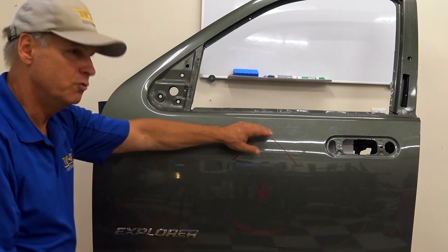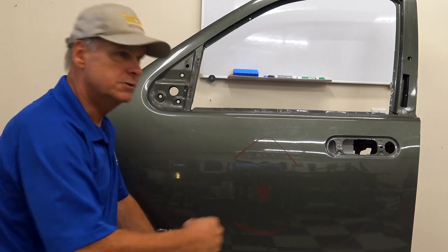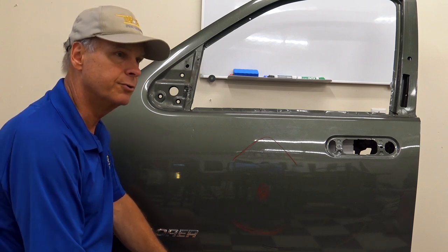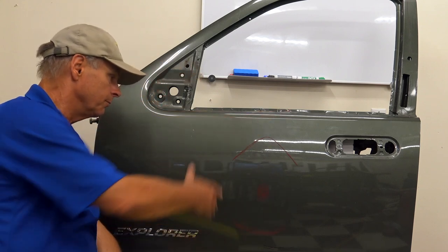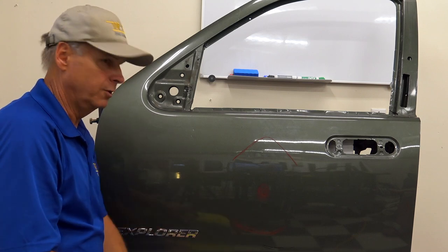I mean, can you imagine if you left both springs in and you're sitting there horking on that metal, you wonder why it's not moving? Why are you having to, and it's fighting you because you're leaving huge pressure traps locked up in that middle. That's that residual pressure, okay? So you take your horizontals out first, you look, you go, okay, my vertical is like, no, relax, that's really cool. Okay, now can you start picking up your metal?